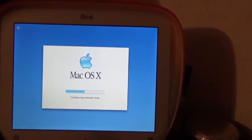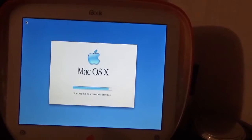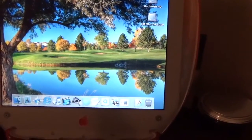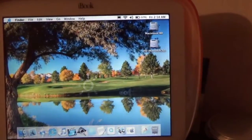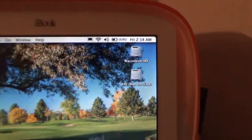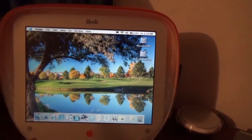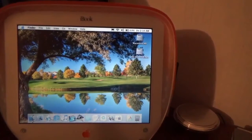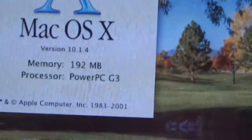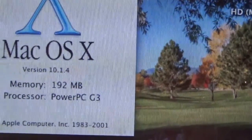This is version 10.1, code named Puma — 10.1.4. I just stuck it on here for now because that's the only thing I have that will run on this computer. I don't have a copy of Jaguar or Panther, so I'll have to look for one. My original plan was to install OS 9 on this computer, but I did a stupid thing and installed OS X first. OS X does not allow you to install OS 9 over it. I have the drive partitioned with a slot ready for OS 9, but the installer won't run — it boots you into Classic, which I don't want. You have to install OS 9 first, then OS X.